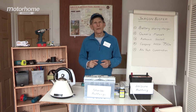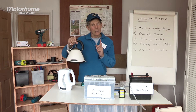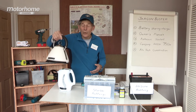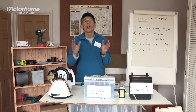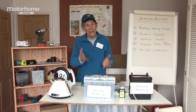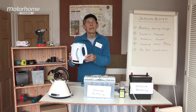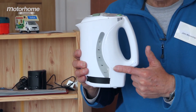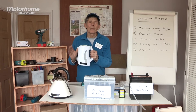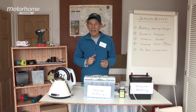Camping kettle — 750 watts. You might say, I don't need a camping kettle, I've got my one from home. No — a fast-boil home kettle is 3000 watts, and if you do your sums you'll find that consumes over 13 amps. A lot of campsites don't provide that amount of mains electricity. So instead of taking that out of the kitchen, you go and buy a camping kettle. It's a mere 750 watts — it takes a bit longer to boil the water, but at least it can run on a typical campsite supply.